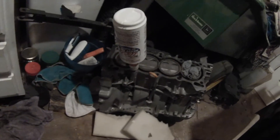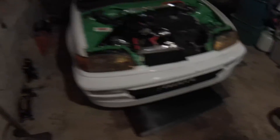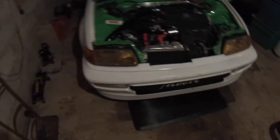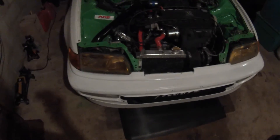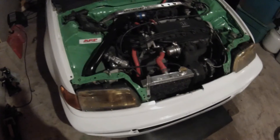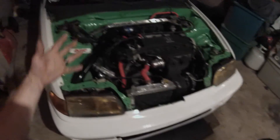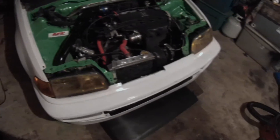And here's the motor I'm throwing in — it's just a D15B7, nothing special really. I'll have the Z6 head on it probably, and a header going into my 3-inch exhaust. It's probably going to be pretty loud. I know it's kind of a long video, but it'll give you a good idea on what I plan on doing for my winter build. I'm hoping to pull this motor out soon and get started early. The money situation is killing me right now, but it will be a pretty nasty car when it comes out. I might keep the Y8 manifold just to see how fast I can get it down the quarter mile, because I've seen 11s and 10s off stock manifolds before — and mine isn't stock, I've modified it. Then I'll need a really good dyno tune and hopefully be up at 400 horses or more. I know my setup right now is capable of 450.